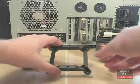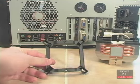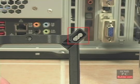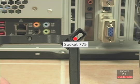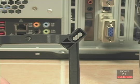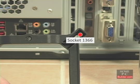The cooler comes with an Intel mounting plate. On each corner of the plate, there are three holes for pushpins to go through the mounting plate and through holes in the motherboard. The holes closest to the center of the plate are used for installation onto a socket 775 motherboard. The middle holes are for socket 1156 motherboards, and the outer holes are for socket 1366 motherboards.